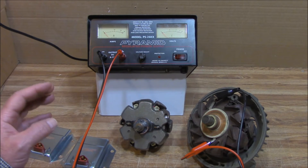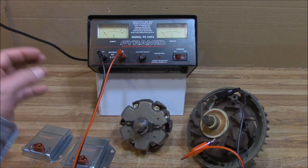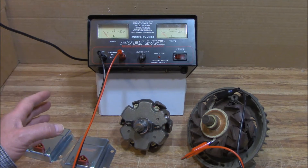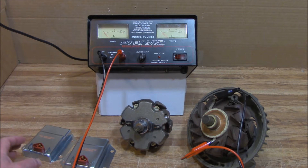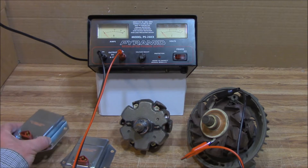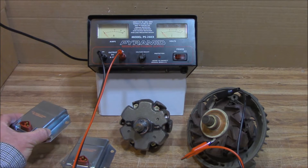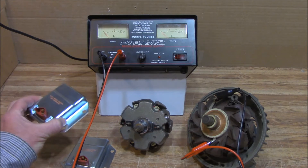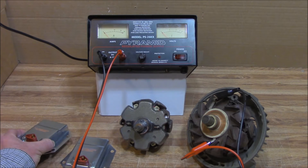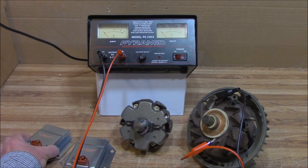The reason I'm doing this is because a lot of people are just going to the auto parts store with the Chrysler upgrade voltage regulator bypass kit and buying the old regulator from pre-87 Chrysler vehicles. The problem is those old regulators really aren't heavy-duty enough. What I've got here is the C8312 from our website, which is like the early-80s, prior-to-87 Chrysler regulator.